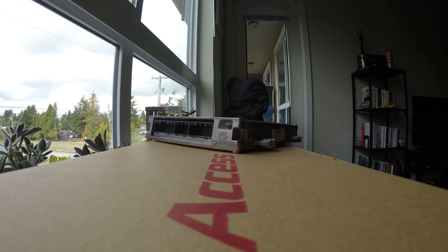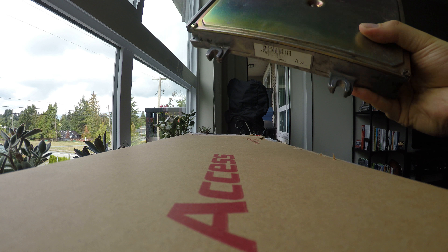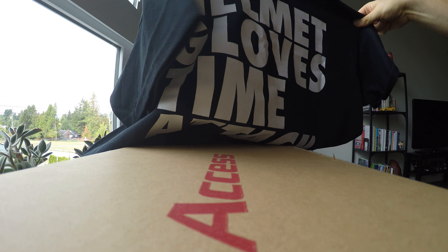I'm going to go OBD1 and start running coil on plug. With the coil on plug and the AEM, it just doesn't work out — you can't run your tachometer and there's a bunch of other problems. I think I'm going to hold on to the AEM Series 1 for a bit because I did put a lot of money into tuning it. Another reason for running the Honda ECU is you get a better base map to start tuning with — the fuel curves and stuff are way better at startup.